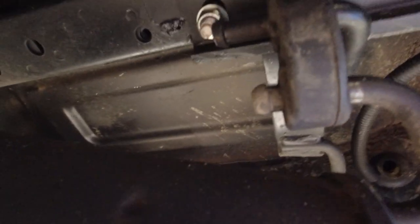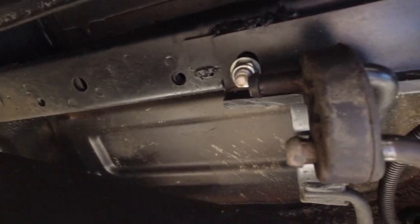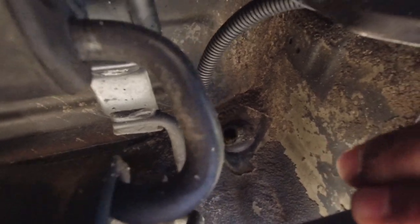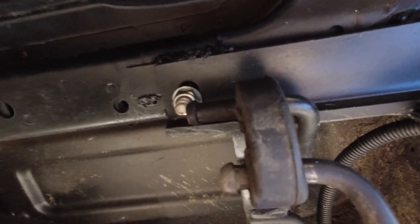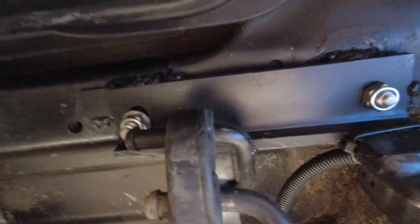And looking up to the floor, the body of the vehicle, you want to make sure that there's no hidden rust spots around those drain tubes, because if they get blocked, water, silt, salt can basically sit there and rust those areas out. And looking at the rear chassis frame of the vehicle, you want to make sure it's nice and straight. This one's got the tow bar fitted to it, so I know it's nice and straight.